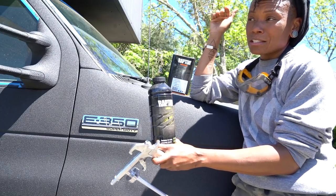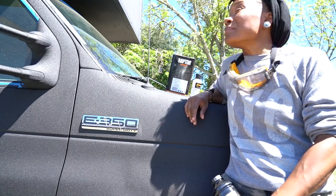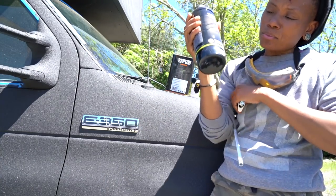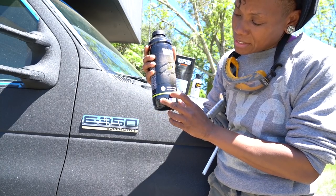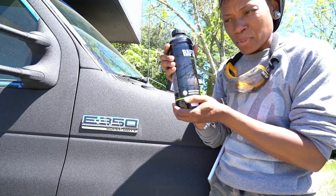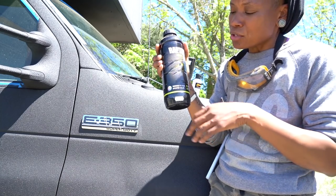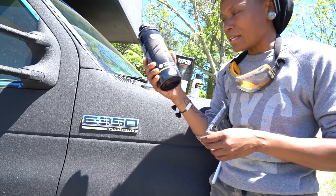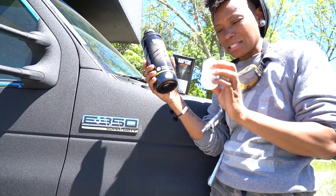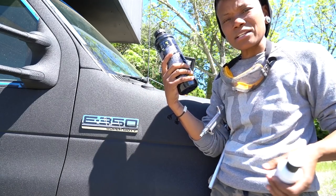If you're working with a color — for instance, the very top of Shadow: I painted the roof white to help with heat, and all of the corrugated steel at the top is a dark charcoal gray — in that case it comes with a tintable bottle that's ready for you to mix in whatever tinting color you want. In the case of my charcoal up top, I poured in a small bottle of charcoal into the container, added my hardener up to the line, shook it up, attached it to my gun, and it was ready to go.